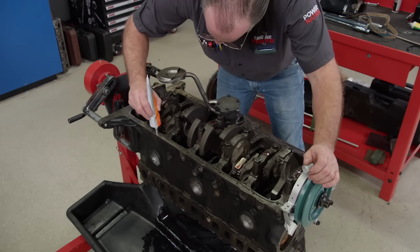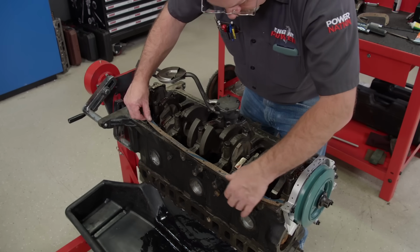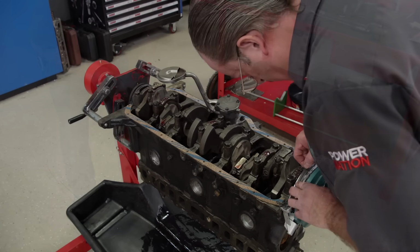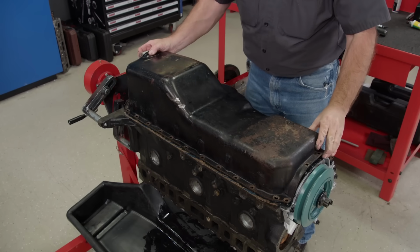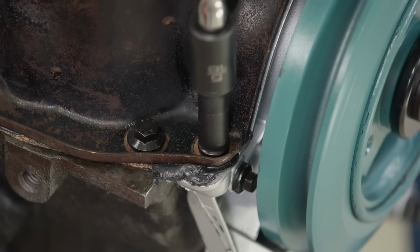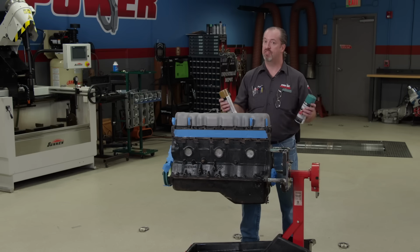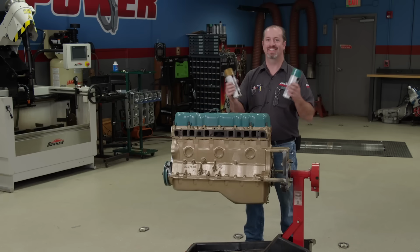Before the cork oil pan gasket goes down, we'll lay on some black weather strip adhesive. The rubber end gaskets are next. Finally, the stock pan goes on. We now have the engine back together to a point where we can apply some color, hence the name Aerosol Overhaul. What do you think?